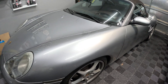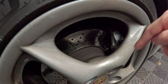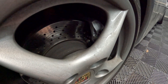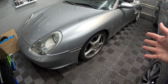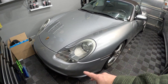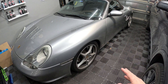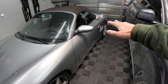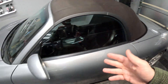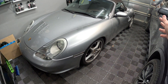There are a few things I have in mind for the car. I'm going to be doing the rotors all the way around — as you can see these are pretty grooved up — and going with a more aggressive pad to help with autocross. I'll need to do tires in the spring; they have tread left but they're getting a little old. I also want to clean out the front radiators and then do a suspension overhaul — all of the control arms through the rear, with monoballs up front and stiffer bushings all the way around.